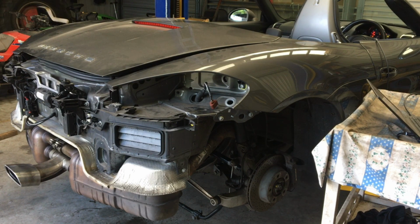So I'll put it into rolling test mode. Once you've done that, you can then go back into the transmission control and have a look at the outputs from the distance sensor if you want. But the easiest thing to do now is just put it into drive and then gently put your foot on the accelerator, or a stick on the accelerator, allow it to run through the gears, take the foot or the stick off the accelerator, let it come back through again, select reverse and do that over and over again just to check that everything's working okay.